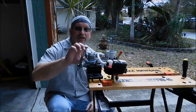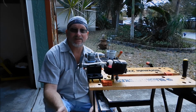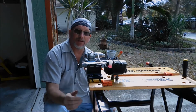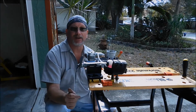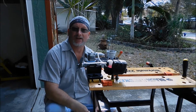As you can see, this is a pretty nice running engine. Turn that 10.6 APC over 11,000 RPM quite easily. I backed it off and richened it up a little bit because I don't want to run it too lean like that. Even though it's not a ball bearing engine, it still isn't a good thing to run an engine that lean. But the point is, this is an excellent running engine and quite an easy hand starter too. Pretty nice.